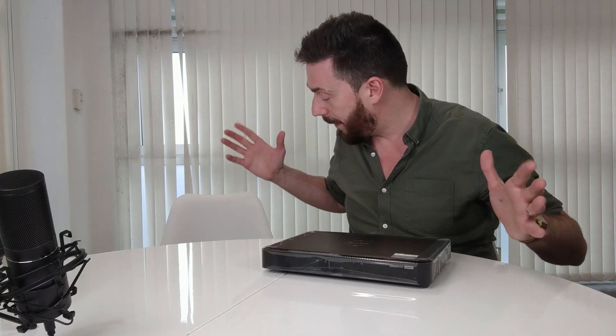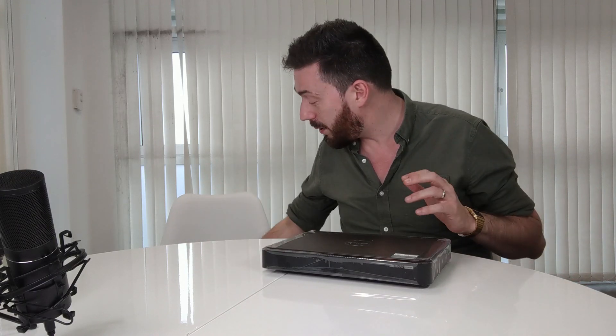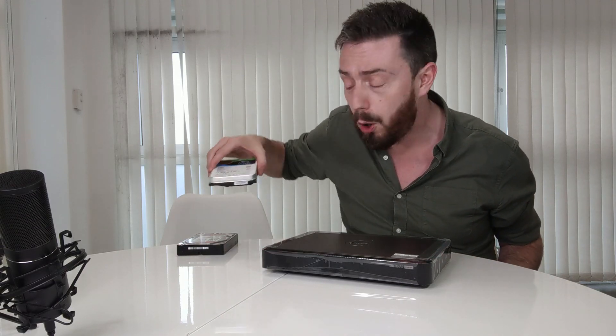This system takes advantage of a heat dissipation panel on the top, alongside a lack of fans on the rear, making it genuinely silent — not just whisper quiet. It's important to remember that it does depend on the drives you use. Traditional hard drives make their own vibration noises, and enterprise drives can be even noisier. For a truly silent NAS, you'll want to use 2.5-inch drives. Nevertheless, this system is legitimately silent.